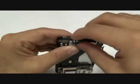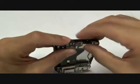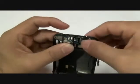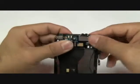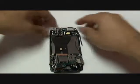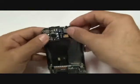Take the power button flex cable ribbon, properly place it into its correct spot, fold it into the top of the back housing, make sure it's still clicking, push in all the sides of the top and the bottom. Once the top is properly secured, go ahead and take that Phillips screw that we took out earlier and place it back in onto the top of the motherboard.